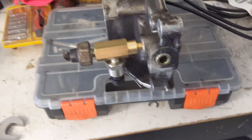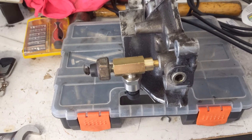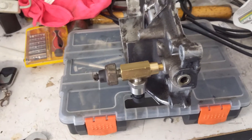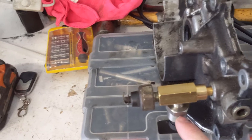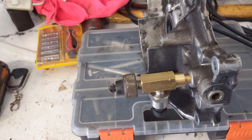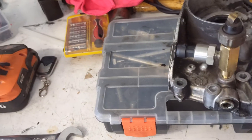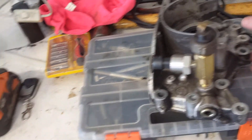The reason I'm doing this is I have a Mishimoto oil cooler sandwich plate installed, replacing my old sandwich plate. The Mishimoto sandwich plate only has one one-eighth NPT port on it and I'm using that for temperature. So in order to monitor oil pressure, I had to find somewhere else to fit one, and the location is here in the oil pump.